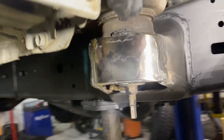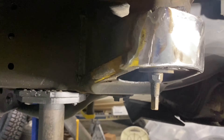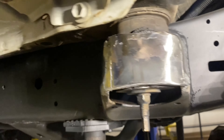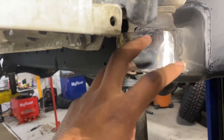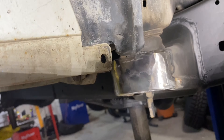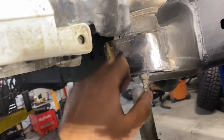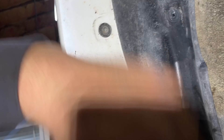Pretty much welded in and grinding it down. I had ugly welds and then made it look pretty with my angle grinder and grinding wheel. I went ahead and cut this across and tried to get it as factory-looking as possible. Next step is to clean it up — just put some brake cleaner on it, wipe it down, then spray it with some coating. Next we'll be working on trimming the body seam.